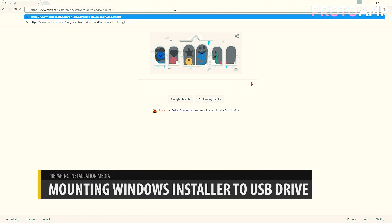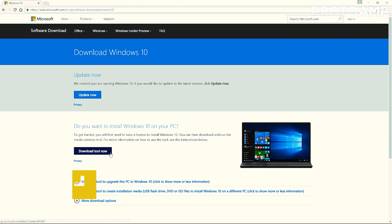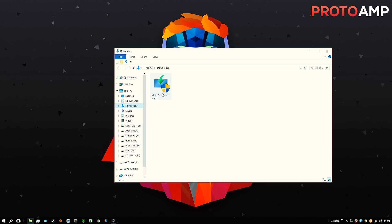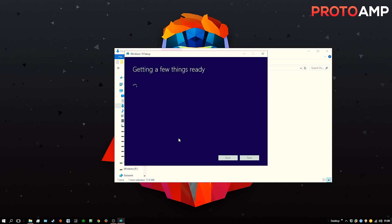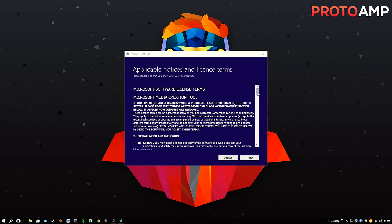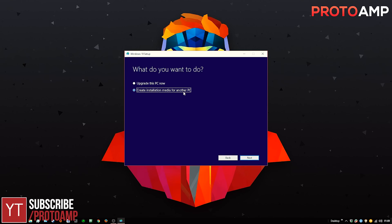Next, we're going to get that Windows installer onto the memory stick. Go to the Windows software download page — link in the description — and click the button that says Download Tool Now. After it's downloaded, make sure your USB stick is connected to the PC, and either click the icon on the bottom left of the browser or go to File Manager and click on Downloads. Double-click on the Windows Media Creation Tool. It should pop up with a Smart Screen page asking if you're sure you want to install it. Click Yes and let it run, then accept the EULA. On the next page, since we want to install Windows on another PC, select Create Installation Media for another PC, and click Next.